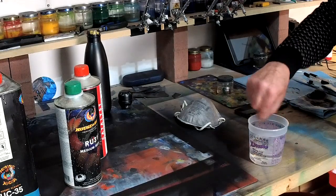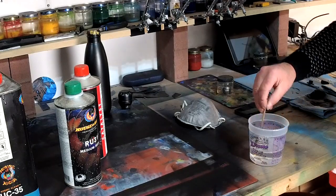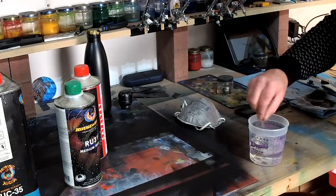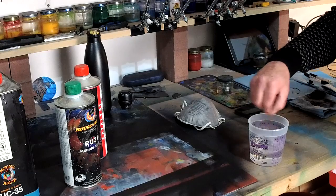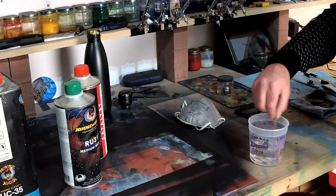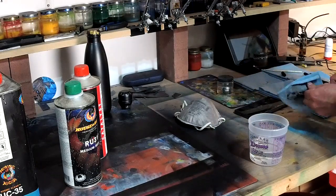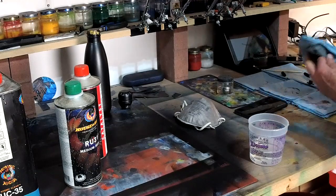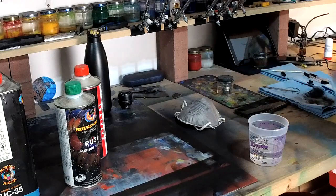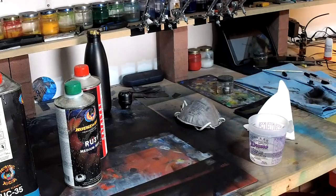And I'm sorry, I forgot to mention the air pressure that I'm running at. So yesterday for the base coat and for the clear coat today, I'm going to be running at probably right in the neighborhood of about 20 pounds of air pressure. That's more than enough to lay your clear down nicely. And like I said, we'll be using the LPH80.